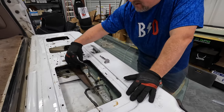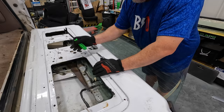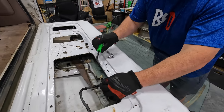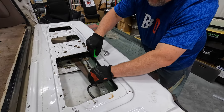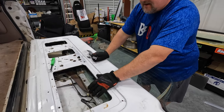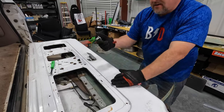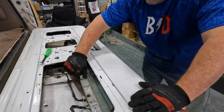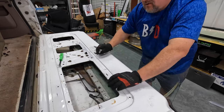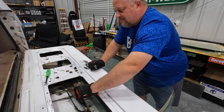Now we're ready to get this glass out. Come in here to your wiring and undo these clips — got that one, got this one on this side. Grab a clip tool — these are great, if you're going to do much of this spend a couple bucks and get one, it's a whole lot easier than a screwdriver. Pop off all these little clips to get the wiring out of your way. Now what you're left with is a couple of nuts — two on this side and two over here. These are a little trickier to get to but a shallow wrench will get in there. They look rusty but they're not super rusted on. Some of you may need a little lubrication before you start.